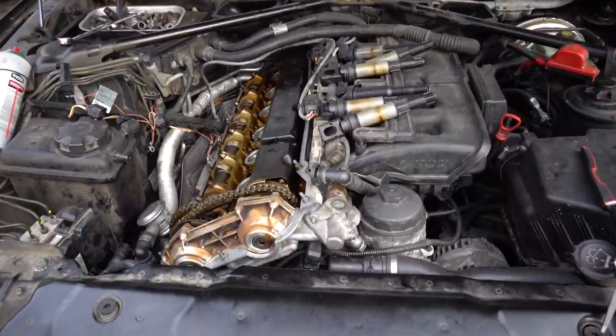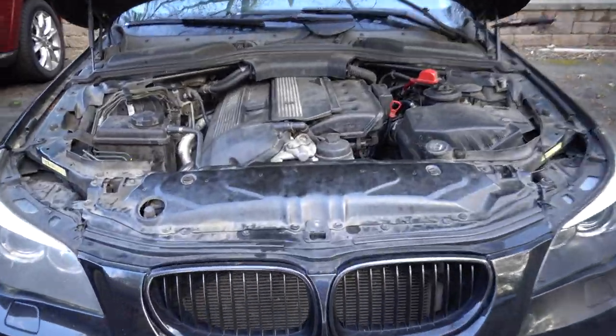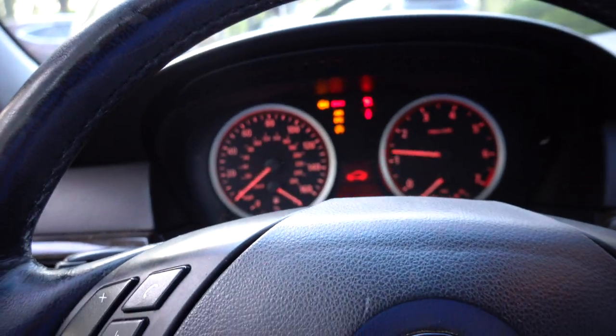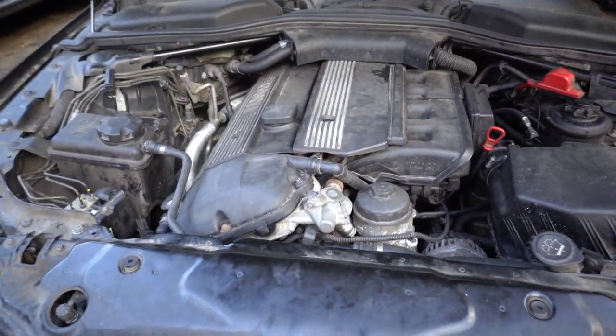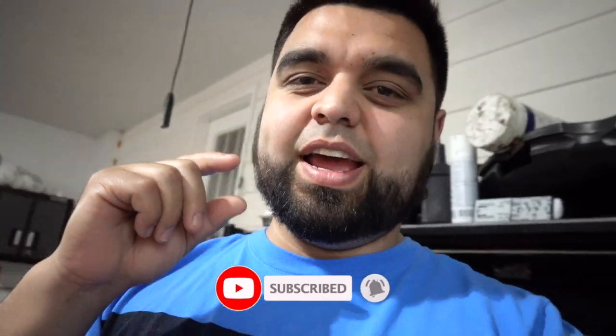The vanos kit is completely installed now. Let's go ahead and install everything else — we wiped it off, so now let's put it all back together. Everything is put back together, now all we have to do is start it. We're good to go. They say it's best to drive the car for about 200-300 miles keeping it under 3000 RPMs just to let the ring seals seat all the way — then you can get on it. If you guys want to know how it goes, make sure you're subscribed. That's going to do it for this video — hope you enjoyed it, smash that like button, subscribe to the channel, hit the little bell icon. As always, keep moving forward and stay on the gas.